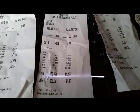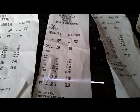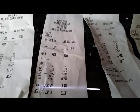So I hope this helps a lot of you guys, when it comes to understanding that these motors have so much potential even stock. This is a high mileage, doesn't smoke, doesn't use oil though, but it's high mileage, 5.3 liter out of like an 02 to 03 Silverado, stock cam, stock head, and the motor's never been touched. It's never been opened. The valve covers were taken off, and a set of drop-in springs were put into it. And then just one of my 76 millimeter turbo kits.